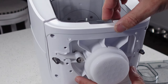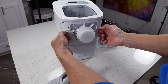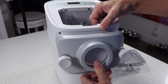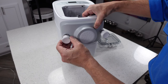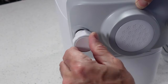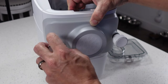This is also how you change to different pasta shapes — whichever one you want to use just goes on here, and there's a notch on top that you line up so you can't put it on the wrong way. Without the cover on, all of this stuff is a little bit loose — there's nothing to hold it together except pressure on these two screws. When you're changing pasta types you do need to hold the machine together as you're putting the cover back on and screwing it in, otherwise it could end up lopsided and you might not line up on those screws correctly. A good tip: turn the knobs counterclockwise a couple of times before spinning them clockwise to make sure everything is lined up properly before tightening down.